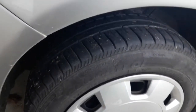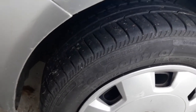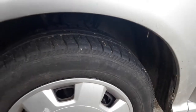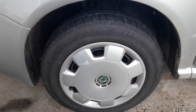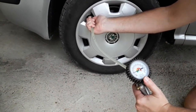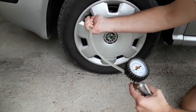Make sure that the tire tread is deep enough. Check the DOT mark on the tires — namely the production date — see that they are not too old, and that the tires are for the present season. Don't go to a vehicle inspection in the winter with summer tires. Also check the tire pressure and make sure it's okay. Insufficient tire pressure can affect other systems like the suspension and may affect passing the test.